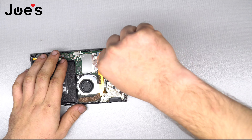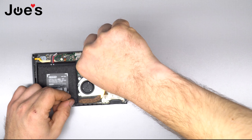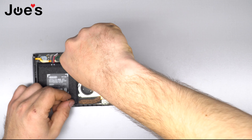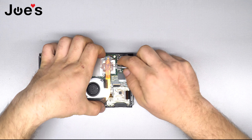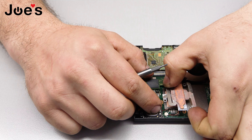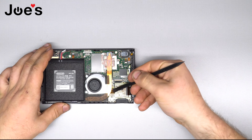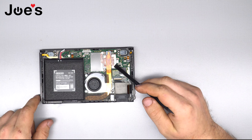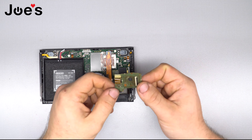Once that's opened, you can just pull that ribbon out, and there's one Phillips screw holding this down that we take out right there. Now we're going to unscrew the heat sink — three Phillips screws, all the same size as every silver screw on these. That's quite nice because it makes repairs a lot more simple. Now carefully pull this up, pry and get under that copper piece — it'll come off quite easily. We can then grab a pry tool to undo this clip, and pull this out. It's not necessary, but it gives you a bit more wiggle room.